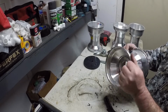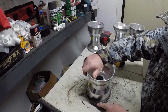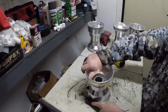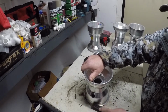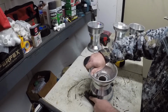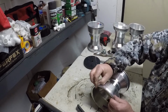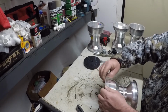Because, like I said, having a flat out on the track sucks. It's happened to us several times. Well, so about 3 times that I remember. And then we grew wise to it, and that's the reason this silicone's on these wheels. Is the ones that we thought wasn't going to seal. I put silicone on the bead to make sure it did seal. Because some of them, whoever dismounted them, tore the beads up a little bit, and I think there's 3 or 4 of those tires that I got off that guy. They leaked around the wheel.